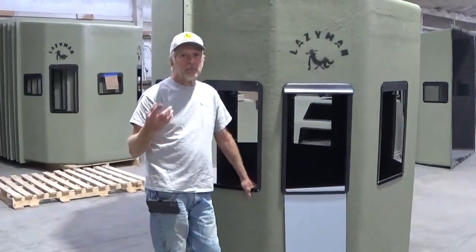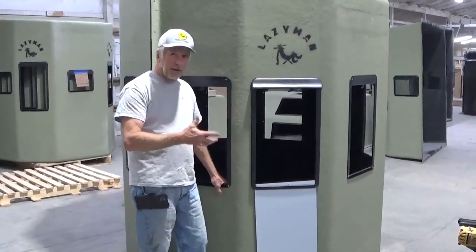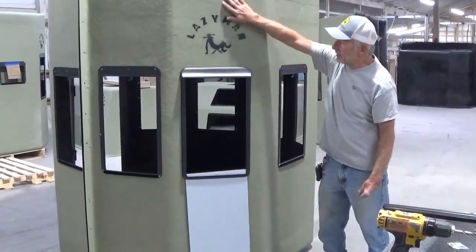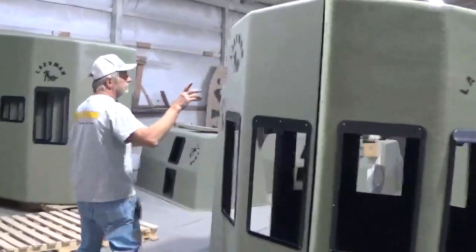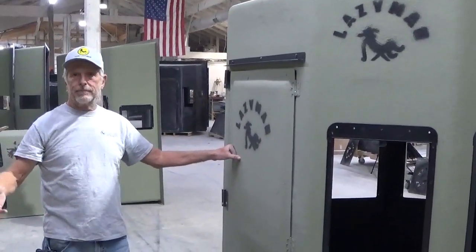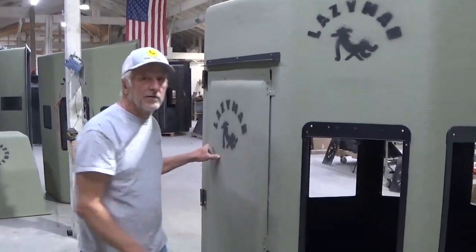We have one other part that we don't do at our facility, and that is the last waterproofing. I recommend 100% silicone. You start on the outside and go around the complete area around the window and down the side. That keeps any water running down the sides from coming in the blind window. One last part is above the door — this visor. Those are our only two points where water will come in. We don't apply it because it takes a while to cure, and the time we work these through the systems it would be too much. And you don't want the windows on while you're traveling.